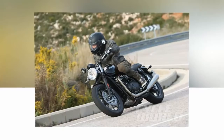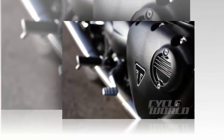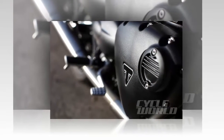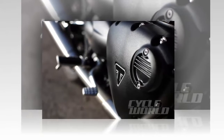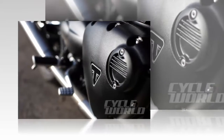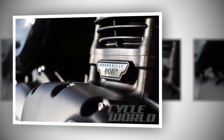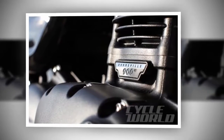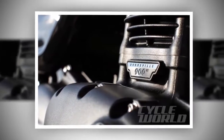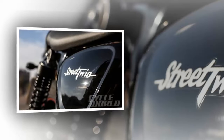The Street Twin's fuel management design results in increased fuel efficiency, with a claimed 72.8 MPG at a steady 56 mph, and 52 MPG at 75 mph. What we did verify is that when the bike is ridden hard for extended mountain miles in second gear, dragging toes through the turns and railing up to redline, our mileage was 47.3 miles per gallon — very impressive. This shows the Street Twin achieves a totally plausible range with its small 3.2 US gallon tank that under normal use should exceed 200 miles per tank.